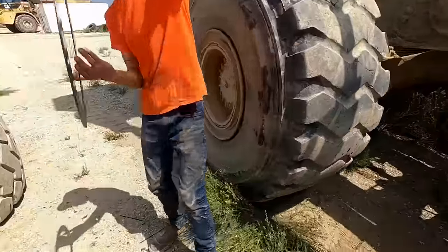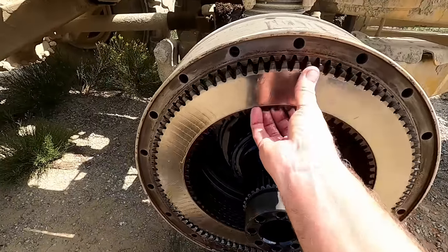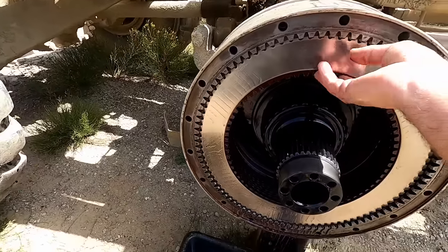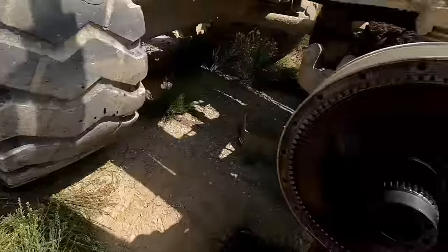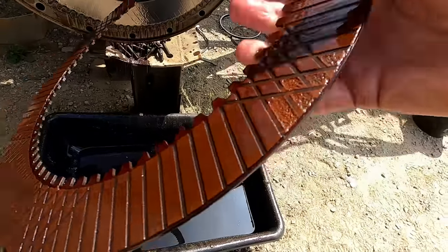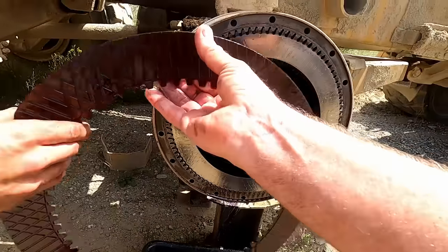What does the other side of that look like? On this side you can see the meat that's on there — we flip it over and there's nothing. It should have material on both sides, and it's even flaking. It was just failing on both sides. We'll save the plates and put them in a separate pile. The discs we know are bad, so just lay those on the tire — they can get dirty. As I get farther in here I can see more failing ones, like this one right by my thumb. We'll get all these out and highlight any really bad ones, but we expect to see them all kind of flaking apart the same way.